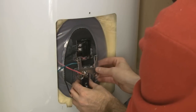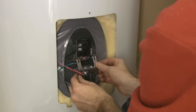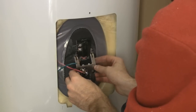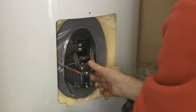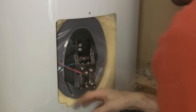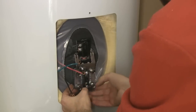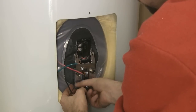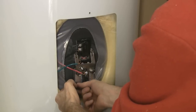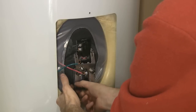Don't forget the retaining clip that holds the temperature sensor on, otherwise you're going to have to take all those bolts off again and start over. Something to be careful of: sometimes these bolts will sit in their clips at an angle. Make sure that they're sitting straight so when you tighten it, the nut and the bolt go straight into the tank — not at any angle where you could damage the bolt threads.